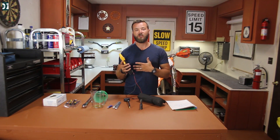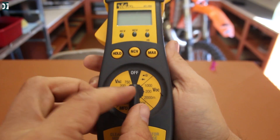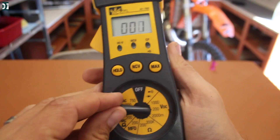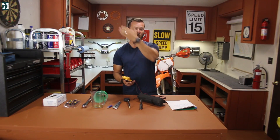If you have a voltmeter you can also use it on your house, your car, and many other things. Understanding it at a basic level is quite essential — it can save you a lot of time. You don't need to know every single function; you just need to know how to check continuity, resistance, and voltage. The values can be found in your manual. Once I confirm the stator is okay, I will move up to the spark plug and check every single component — there are maybe four or five depending on the bike.